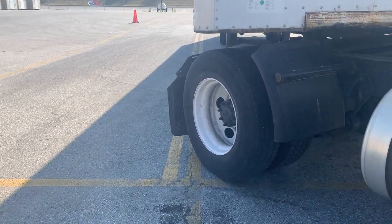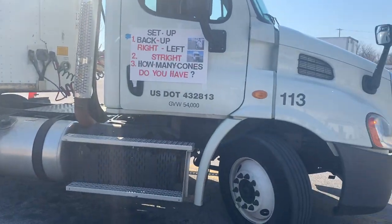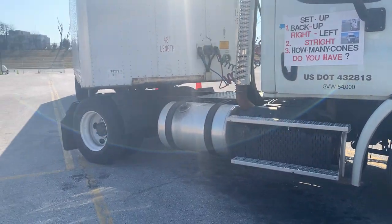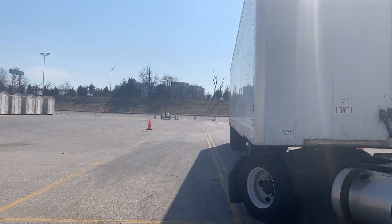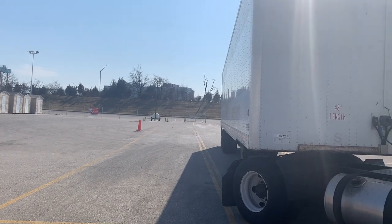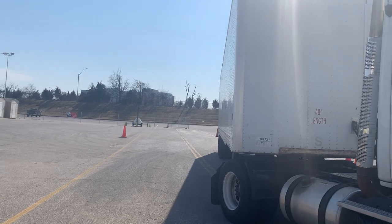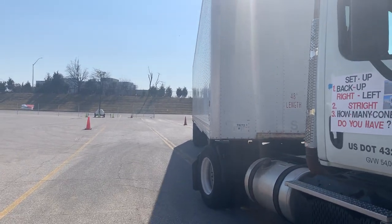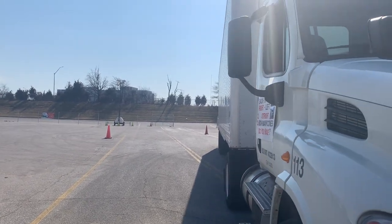And there it is — that gives him that 40-degree angle. He's going to counter-steer with the left. I like to use the big mirror now as a backup. As soon as I see that right side trailer tire comes into view in that big mirror, I'll stop and I will be straight if I stop one time. That takes a little practice. So he's backing up slowly — as soon as that tire comes into sight, you'll have it.